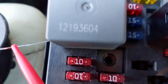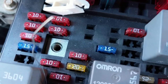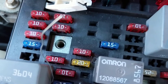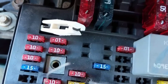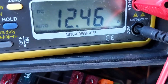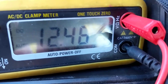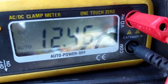This side will always have 12.46 volts. The question is, when the relay is activated, what will the other side have? It should also have 12 volts — and that will happen when the headlights come on. So I don't have to take the relay out, I don't have to jump anything, I don't need a power probe. You'll notice two things: the headlamps will come on, and this is the main point of the relay. I'm going to keep it on the B+ side. The 12.46 will drop — it'll drop to about 12.3. What's significant about that is it shows me that the relay is pulling current. Since it's activated, the voltage will drop. That's why it's important to understand current.